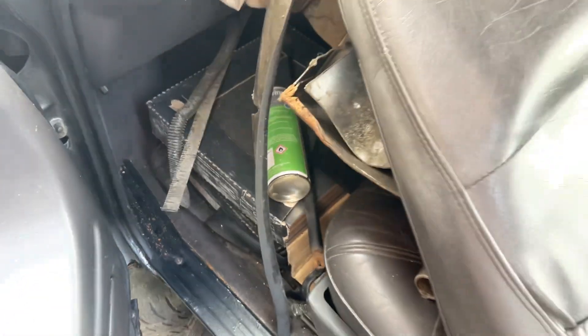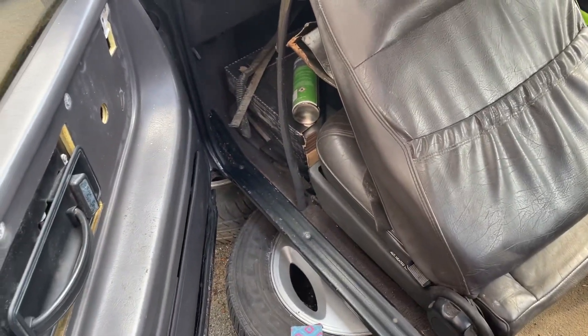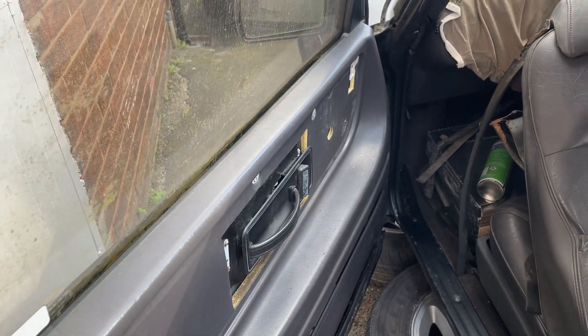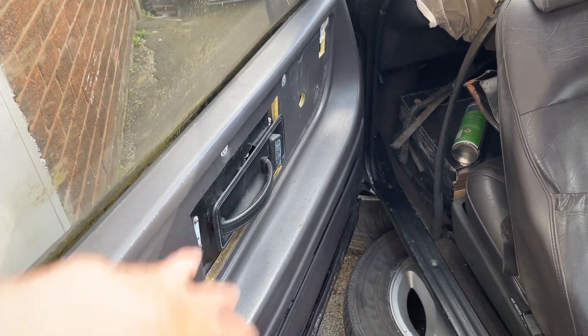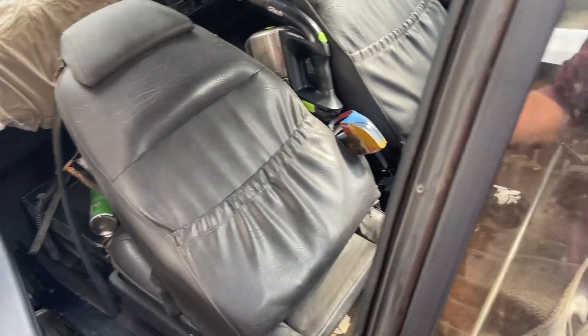There's a little bit of rust down on the kick plate but we'll get to that. The door cards - I've wetted and put them under weight, flatted them down, and spray-glued the original material back on. They've come out quite fine. Boot area next.